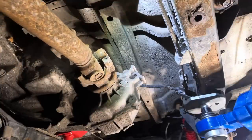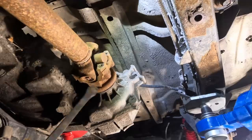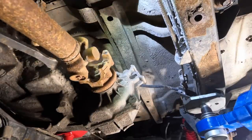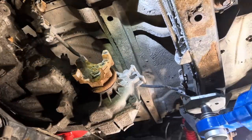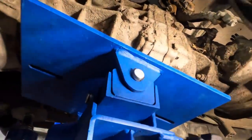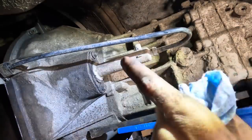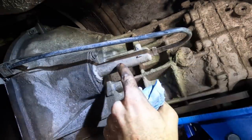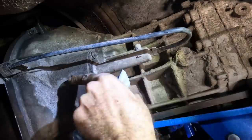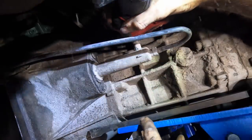It's already out. I'm holding onto the shaft with one hand and working it over. There we go — came right out. Set that aside. Now I think this thing's nearly ready to be unbolted. Pull the slave cylinder next. This is what transfers hydraulic energy from the master cylinder into this cylinder, which then reconverts it into mechanical energy to operate the lever inside of the bell housing, which releases the clutch mechanism.